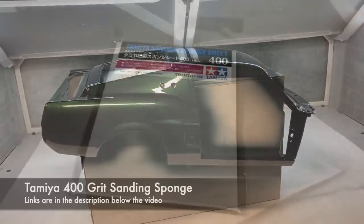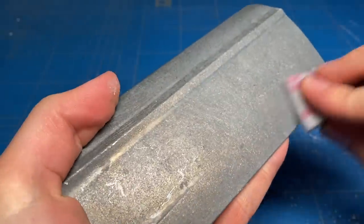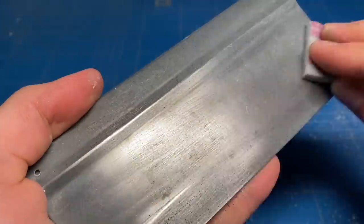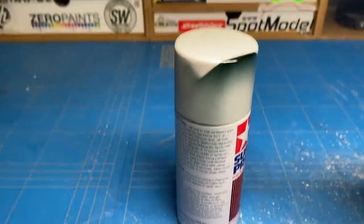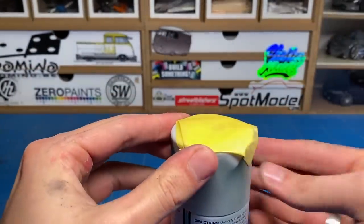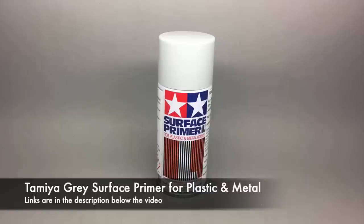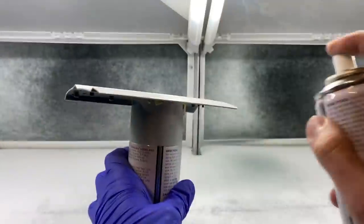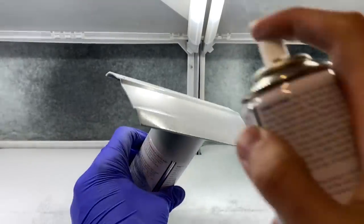With all of the insides of the pieces painted and the main body taken care of, I put my attention to the rest of the pieces: the doors, the fenders, the hood, the trunk, and also the front and rear portions of the body — let's call them the front and rear end rather than bumpers, since the bumpers on these older cars were extra chrome pieces. These were all handled in pretty much exactly the same way as the rest of the parts — strip the paint, paint the inside, then sand the outside with 400 grit, apply primer heavily, smooth with 600 grit, apply more primer for a nice smooth finish, then apply the color and clear coat.